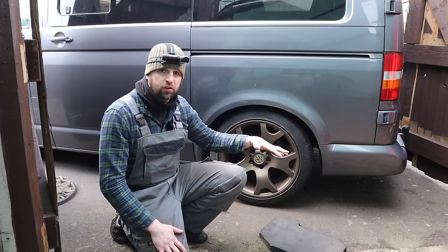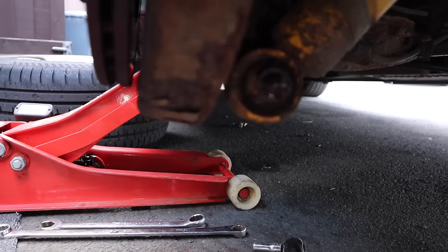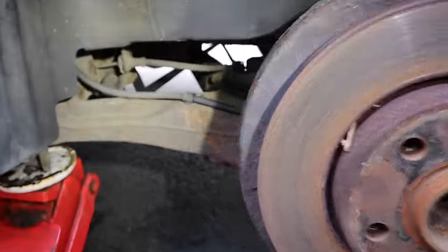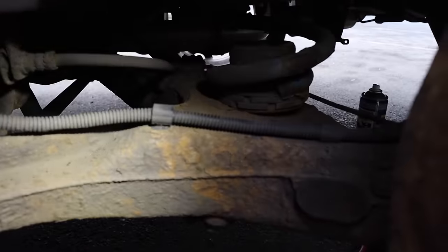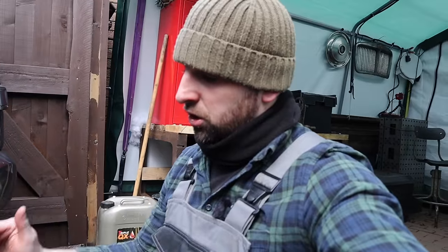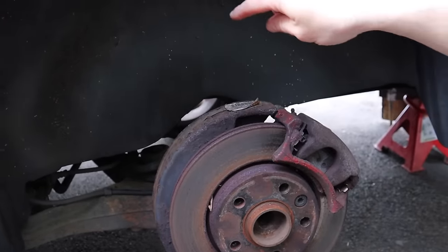Same again - chock up the front wheels. There's a 21mm nut there which comes all the way through, and there's another 21mm head down here. Point to note: it looks like they've put the adjuster on the bottom, when actually the adjuster should be on the top. What we're going to do is undo that 21mm nut at the bottom, which should release the damper so I can move the arm down, get the spring out, and have a bit more clearance to access the top bolt.